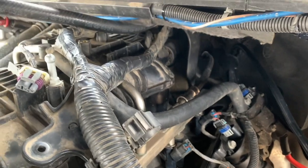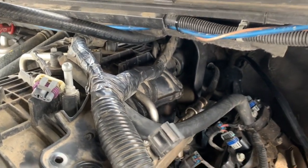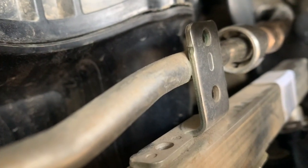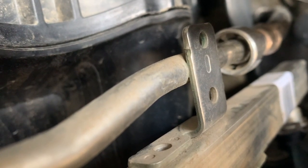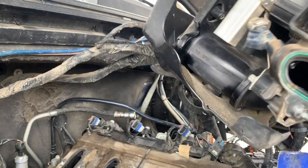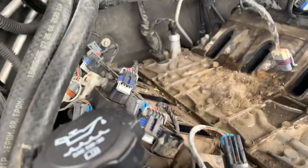Then I'll grab that fuel line. The one I bought from AutoZone is not working — it's not deep enough, so I've got to go grab one. If you look at the fuel line, on the inside there are little clips, and it needs to press and release. Once it presses, pull it out. Got her out.